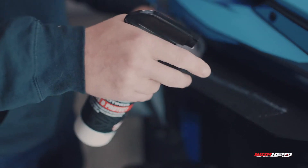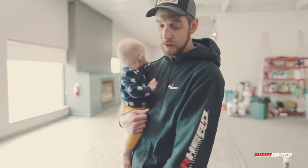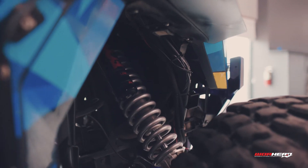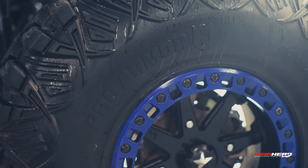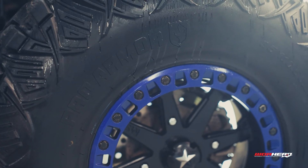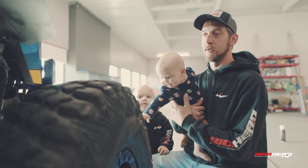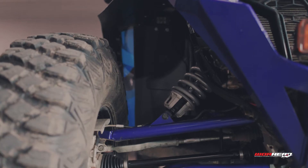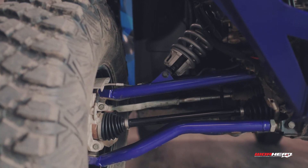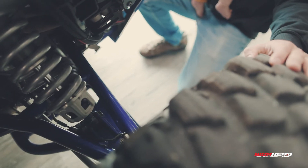It makes cleaning up a lot easier at the end of the day. I upgraded to 35-inch Pro Armor crawler tires with the 15-inch MSA Beadlock wheels. The biggest benefit of these taller tires is going to be your ride quality and also gives you some added ground clearance. Over here I got my Super ATV forward A-arms. I need to run those in order to fit the 35s — if I didn't have those, my 35s would definitely rub.